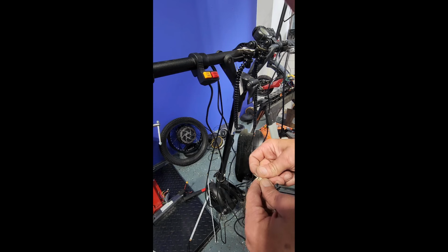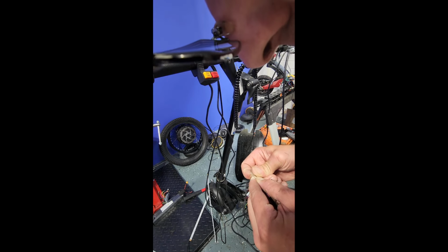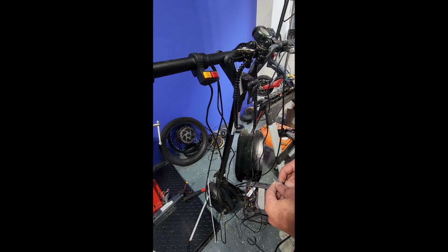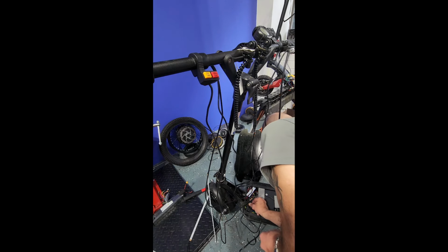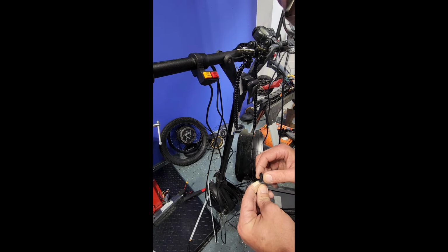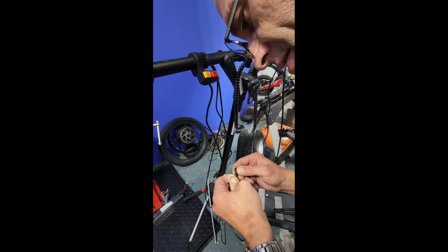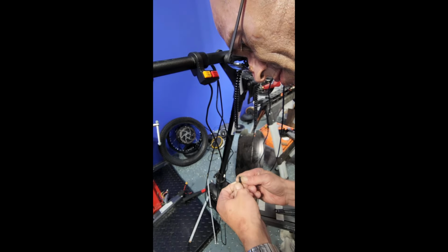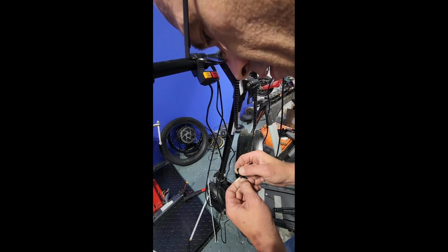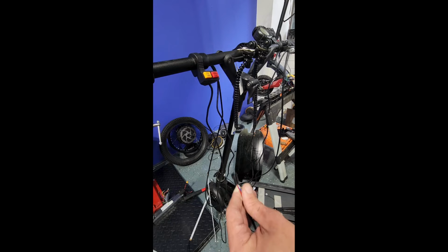Now, if you do have to de-pin the very wire that you're trying to get into place, once you de-pin it, make sure to reflare your pin on the wire lead. Alright, we're going to try this a second time. Now we got it on the right side. Now it's in place. So now we'll go ahead and connect it to the opposing side.